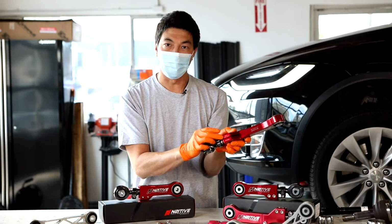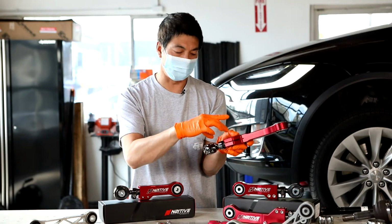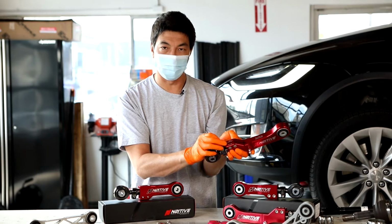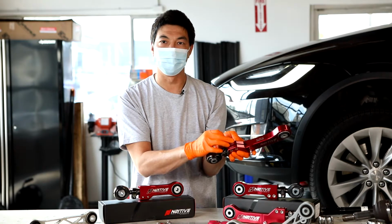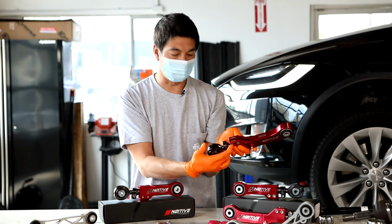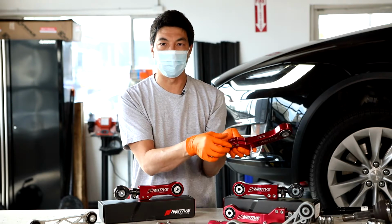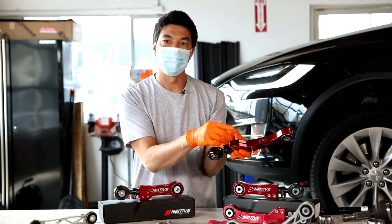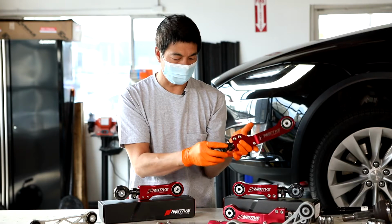Make sure that you torque these two nuts properly once the length of it is set. The nuts need to be torqued to 20 foot-pounds. As you torque them, make sure you go back and forth between the two and try to do it evenly and confirm it. Once you've hit 20 pounds on this one, get the 20 pounds on this one, and then reconfirm it on both, because as you close it down, the pressure is going to be greater on one side, normally leaving the other bolt not at the proper torque spec.